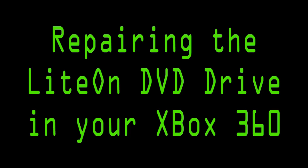This may or may not fix that problem. If by chance something went wrong with the flash on the board that you have — which is rare, but it does happen — you're pretty much screwed. No fix is going to help you unless you flash it back to the original BIOS, which is possible.